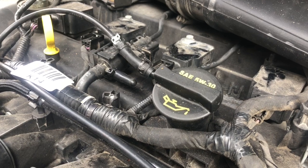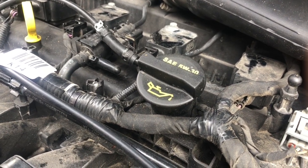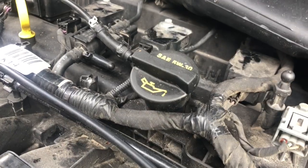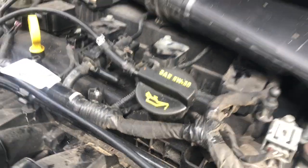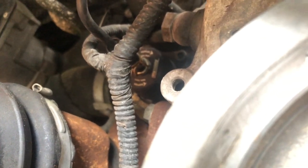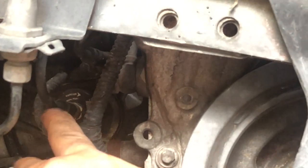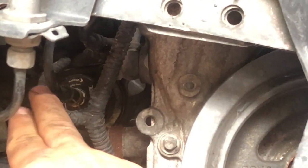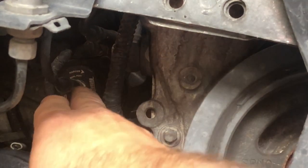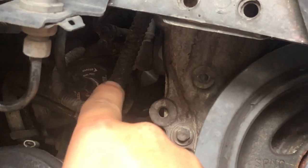Now the next thing I'm going to do is crawl into the car, and I'm going to adjust the blow-off valve. I'm actually going to remove the cylinder, so just unscrew it all the way. So first disconnect the airline, which I'll show you. So we're right inside the front passenger wheel well. Wow, I cannot reach at the same time as camera, but this line right here has a little clip that we're going to remove right there, and then pull that line off, and it's going to let me unscrew that counterclockwise to take the whole thing off.